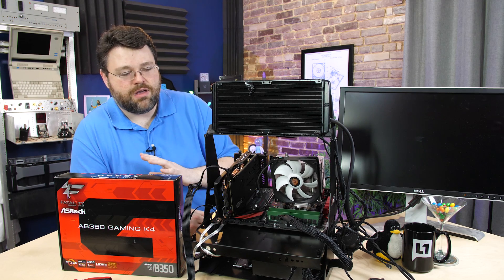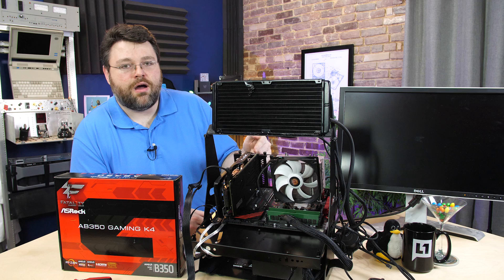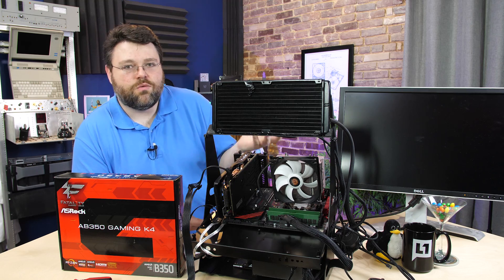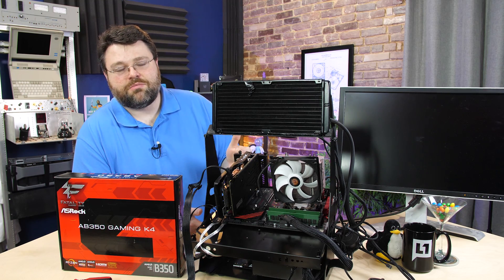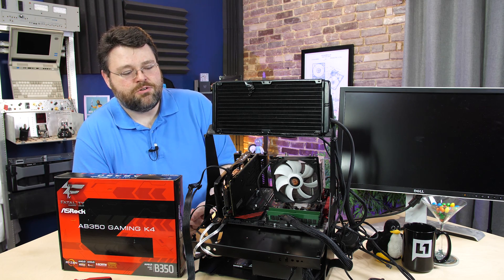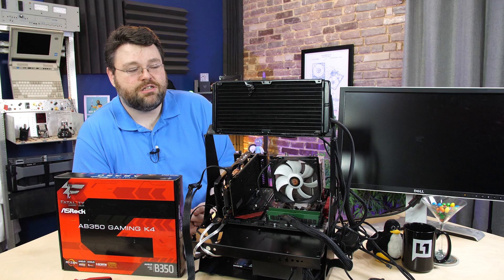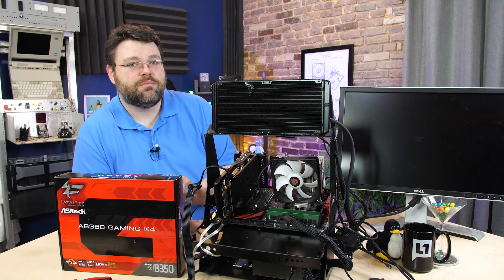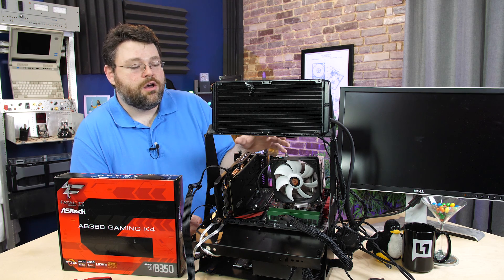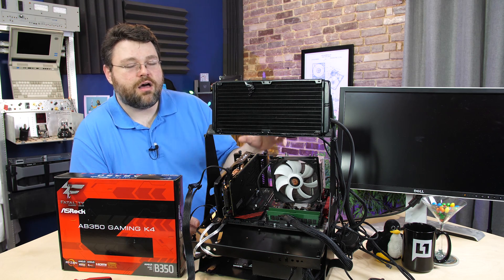Group 0 — everything is in Group 0. The IOMMU layout on this motherboard is basically the same as every other Ryzen board we've looked at, including X370. The only difference here is that ASRock has wired the NVMe lanes into a slot, so it's shared — you can use either an NVMe or a PCI Express device there. And because they've done that, we've got another option that isn't quite as terrible as having a graphics card running through PCI Express 2.0 on the B350 chipset. You're basically using your two dedicated links to the CPU for GPUs in the context of two different virtual machines. That is a good setup.